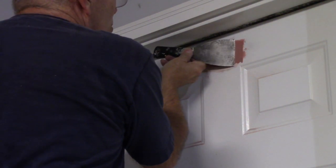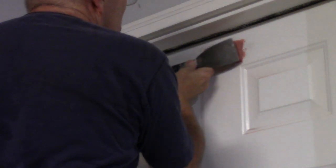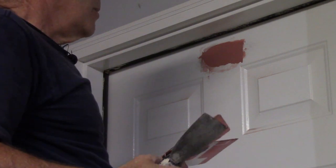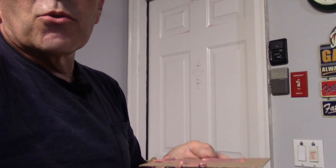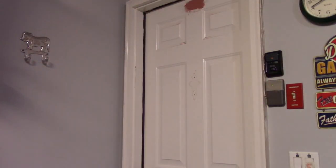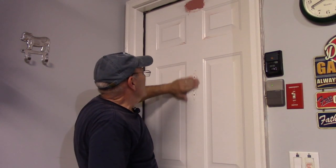Let this dry one more time. Once it dries, we'll sand it with 80 or 60 grit paper and then we'll be finished with that stage. Also, whenever you're working with Bondo, make sure you clean all your instruments off — once it dries, it's just like cement. So clean off all your tools. While the top area is drying, we're going to continue on the door knocker area.